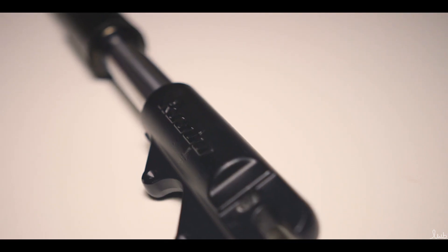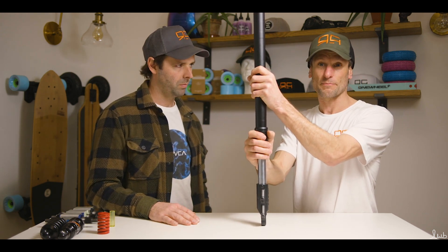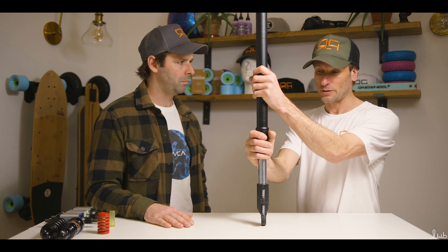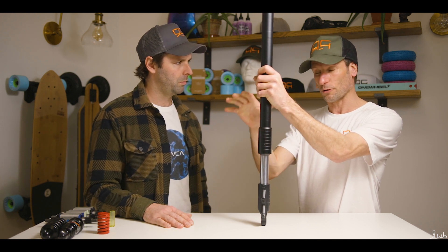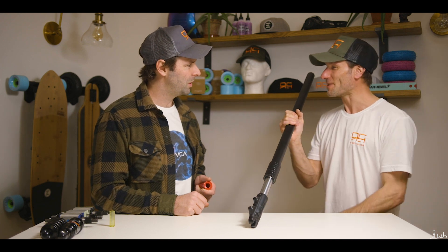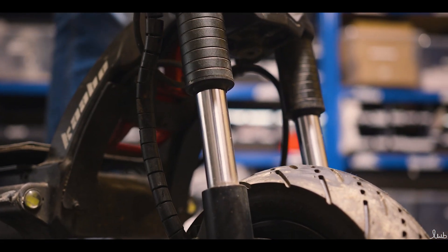This one is not adjustable — that's preset exactly as it is — but you can get them fully adjustable and oil damped. This one is not oil damped, it's oil lubricated just to reduce friction. It's good for on the road and off-road, but you're fairly limited depending on how bumpy the terrain is going to be, and speed will make a big difference. The more speed, the more compression, the more energy, and the greater the release — so the faster you go the higher you will climb. There's no real dampening in the rebound, so when the suspension gets compressed all the energy has nowhere controlled to go. It will just be like a pogo stick — it compresses and then nothing stops the energy from coming back at you.